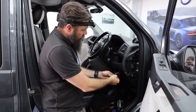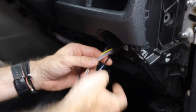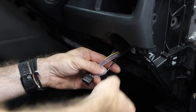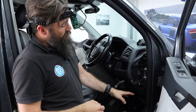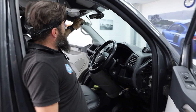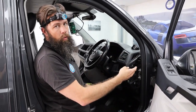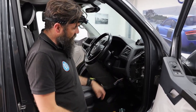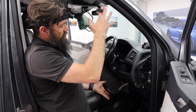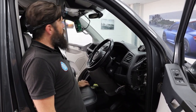The gray-blue in pin number 10 of the light switch plug is your illumination circuit. I've tapped my cable onto what looks like aftermarket footwell lights that were already tapped on there, so they'll all work together — the footwell lights and the little ambient red lights will come on when you turn the light switch on or the lights come on automatically. I'm now going to tape this up neatly so it looks as factory as possible, put the van back together, and then we'll test everything to make sure it's working.